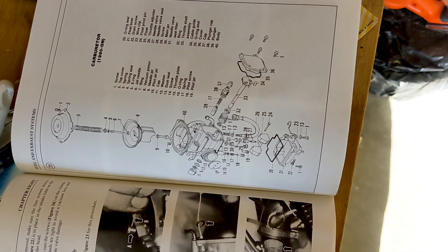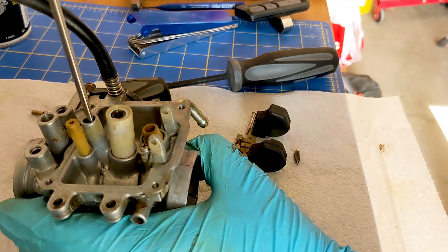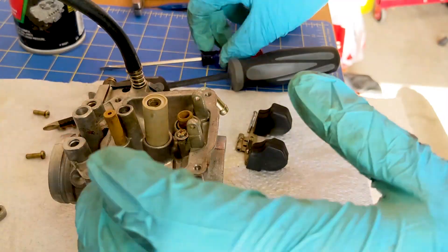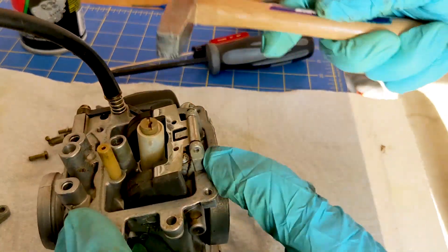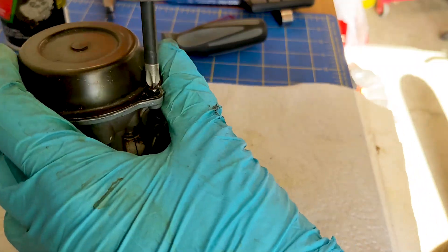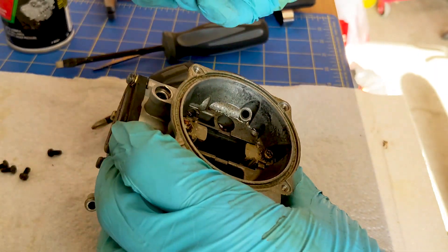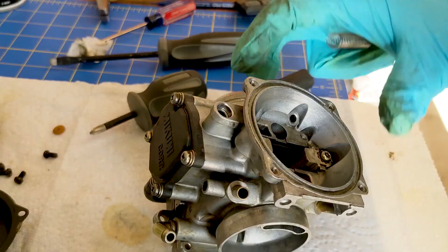I have the book right here as well — I can show you the exploded view of the carburetor. I'm going to take this float out and inspect the needle. Now I'm going to put these jets back in place, and then typically that's it for a carb clean if it's just running a little bit rough. I'm going to check the condition of this diaphragm at the top. Diaphragm looks okay. I'm just going to clean out this part.